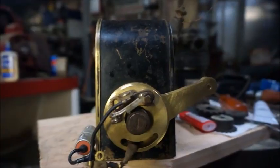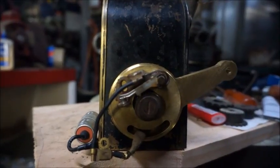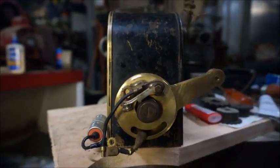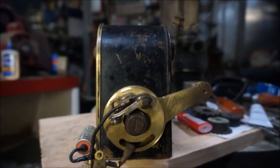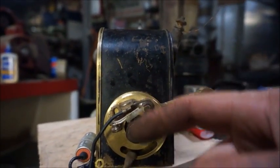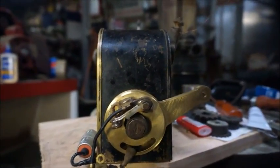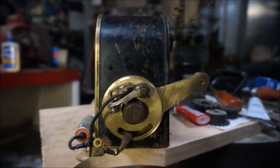I've actually got spark on it — I've just got this thing hung together enough for testing. I wanted to make sure the coil and the magnets were good, and it's actually throwing a really good spark, which surprised me. I'm going to try to get set up where you can see it. Then I think I'm going to go ahead and make the cover that goes over the points. I'll get a new set of points — this is an old rusty set — and I'll make the cover with enough clearance, plus the piece for the spring that holds the cover on. I've got it to where it'll adjust timing really well.